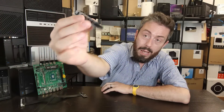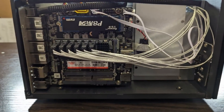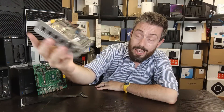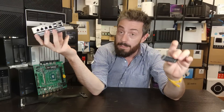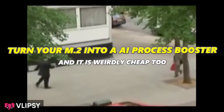The answer? An M.2 to 6x SATA adapter. This adds six SATA drives and allows you to go really compact — even the tiniest of micro boards, as long as they've got one M.2 connector, can use this. That means a tiny board with four 2.5GbE ports, a couple of SO-DIMMs, and an N6005 Pentium CPU can now add six more SATA drives using just one M.2 slot. Six storage drives won't be as fast as a Gen 3 NVMe at x4, but for capacity — imagine six 24TB drives.